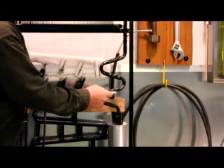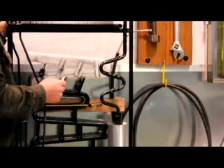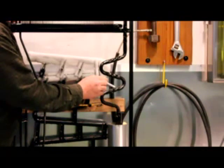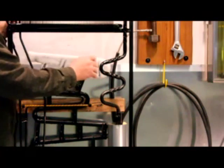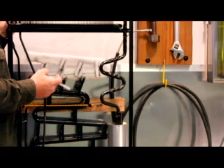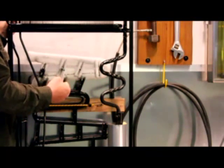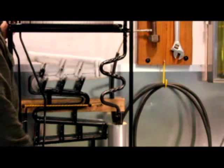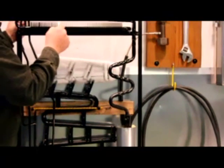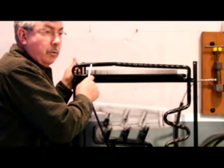As the steam passes through the steam line, it's distilled water and ammonia — a weak ammonia solution. As it passes through, you'll notice these dimples, which create more surface area for the steam to touch the cooling unit and cool. Water condenses quicker than ammonia, so as the water touches the surface, it condenses back to liquid and falls back down to the bottom of the unit, leaving a strong ammonia vapor. At this point the water should be completely separated, leaving you with a strong ammonia vapor.